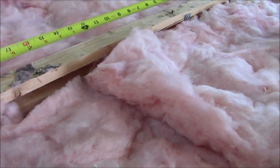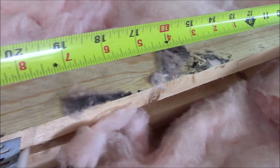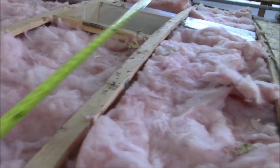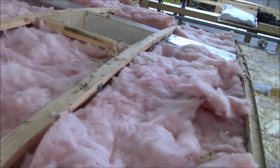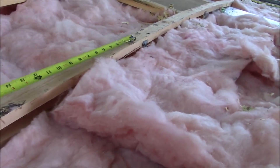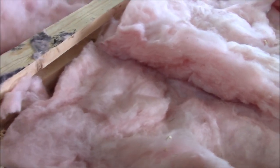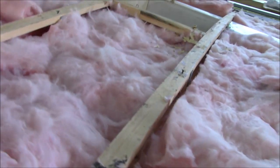This isn't even glued either — no glue. Look how far apart these are. 15, 16 inches apart — that's all you've got for your nailing. Now they did throw a couple of staples up in there to go around that box, and there's a few staples on the edge, but in the field — right here on the body of it — nothing. These are just not enough fasteners. The reason why they don't — I don't know why they don't sew it all up with the staples. They should, especially since they're not going to use glue. They got these things down to a science where they go: only put in X amount of staples, only put in X amount of screws. Pennies and pennies and pennies they save.